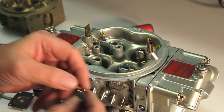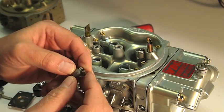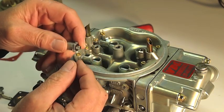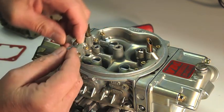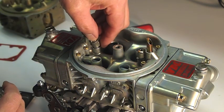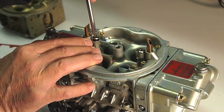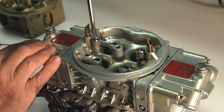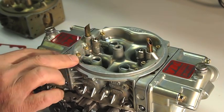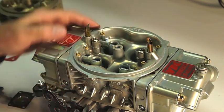That should cure your stuck pump nozzle. Take your screw and put it back onto your pump nozzle — the gasket can come loose so make sure you don't lose it. You can hold it so it doesn't fall off, or place it onto the main body and put it back on. When tightening, it needs to be snug — you don't want it falling off and going down into your engine. However, these zinc castings are not the strongest, so be careful not to strip out your casting.